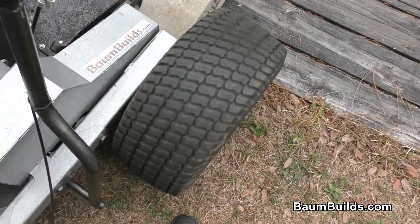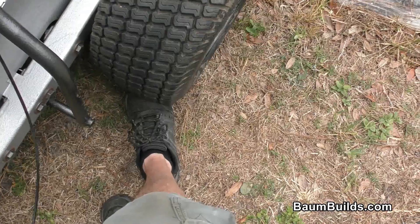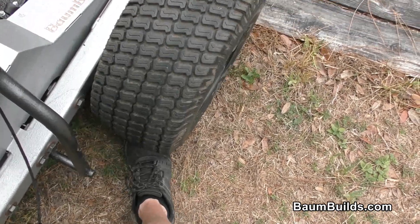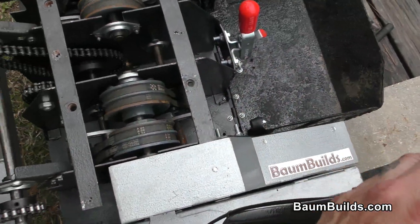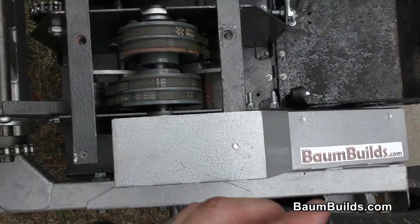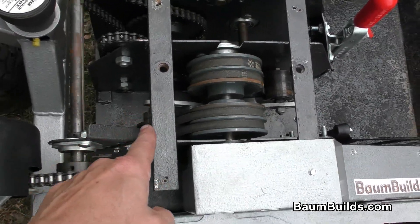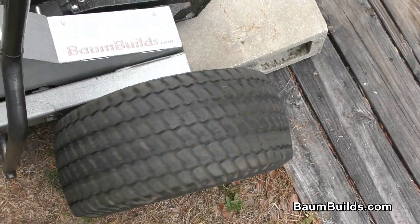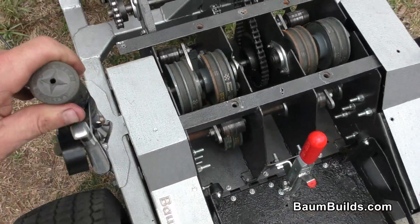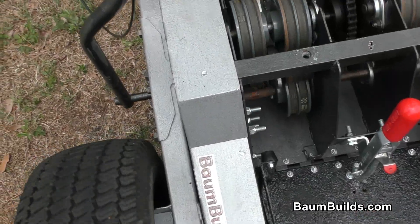This is in neutral — it's spinning a little bit but there's no load on it. Once I put a load on it with my foot it stops — it just bleeds it. When this is on the ground, it doesn't move, it stays neutral. Now watch as I push this forward — you get the wheel starting to go. I'll come back out of it.